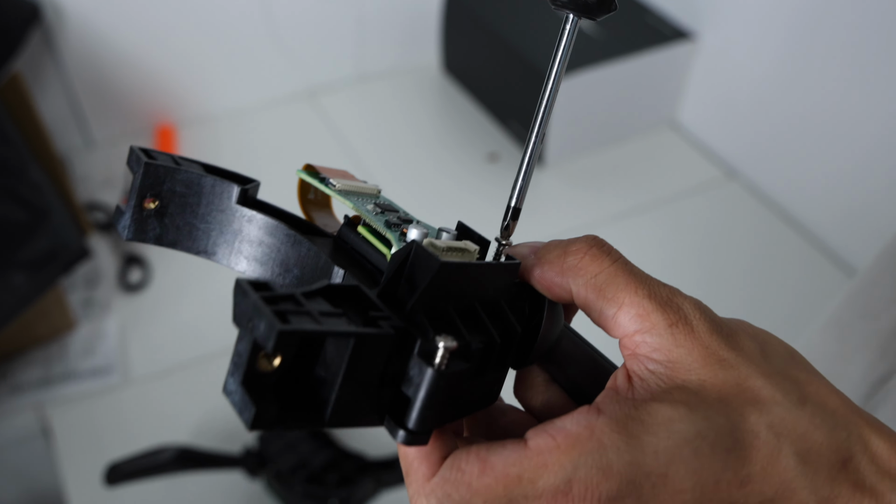And once you've done that, go ahead and go into your Tesla display under control and safety, turn off the power. Once the power is off, pry open the side column cap on the dash. These are the covers that will give you access to the adapter where you will plug in this gear column and lever control. Once you remove that, remove the bottom trim as well and detach, disconnect the ambient lighting as well as the speaker.